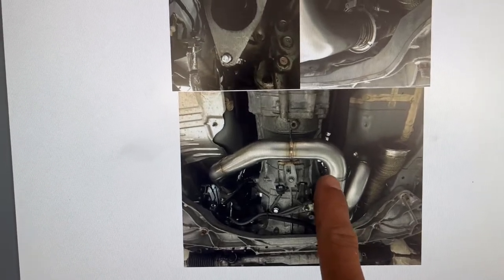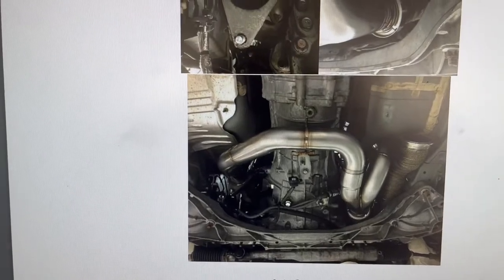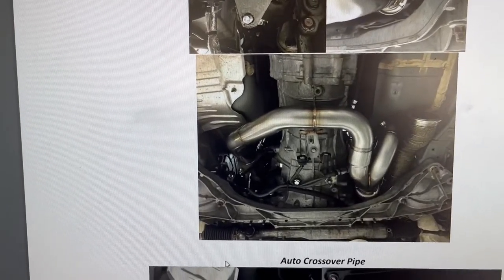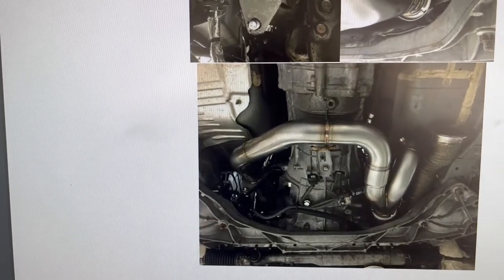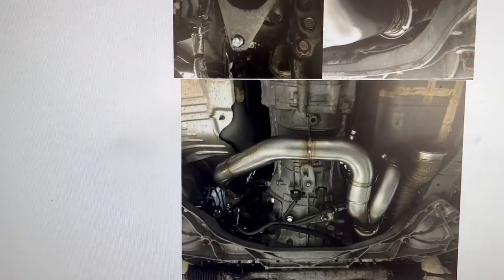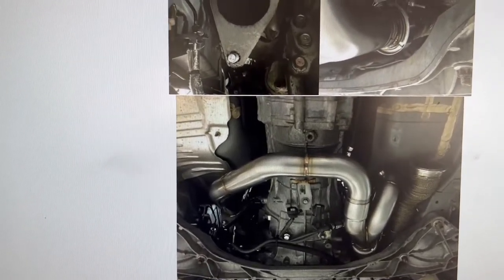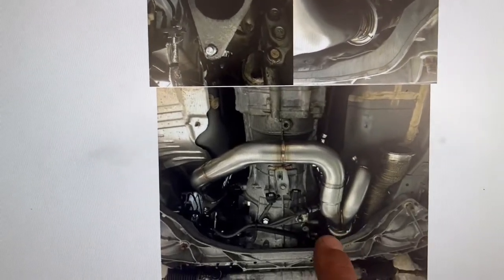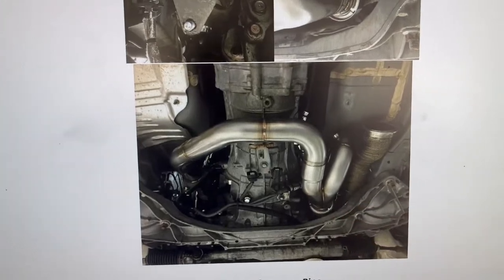Before you put this pipe right here on, which is the U-pipe, do not tighten the top that connects to the turbo. You can put your clamps, but don't tighten them up. Leave them loose, but make sure you have an attachment. This way, the pipe that comes down from here, you're able to at least move it a bit